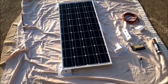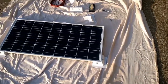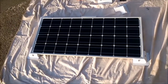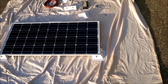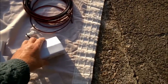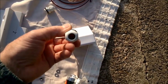First of all you've got to choose your panel. I'm not going to go into the detail of that because there's plenty of stuff on the internet, but probably the best resource is the Caravan and Camping Club. We went for a hundred watt, which is what you can see there. You'll also need brackets to hold the panel to the roof, and then you'll need this kind of cover which is used to take the cables from the solar panel through the roof. We've got a double one — obviously the cables go through there.